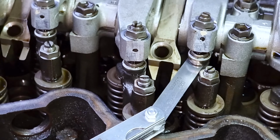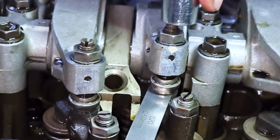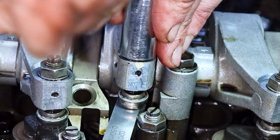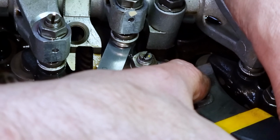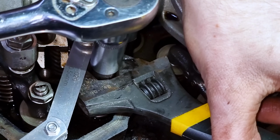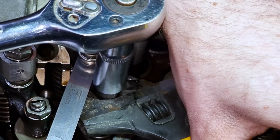Right, so let's crack a lock. Dave will get his... 12mm socket. And remove that first locking nut. So loosen that, and that. Then the adjustable spanner holds the arm so that when you push against the arm it doesn't snap off. And then you use your 12mm socket again, or a 12mm spanner, to remove the fine adjustment locking nut.